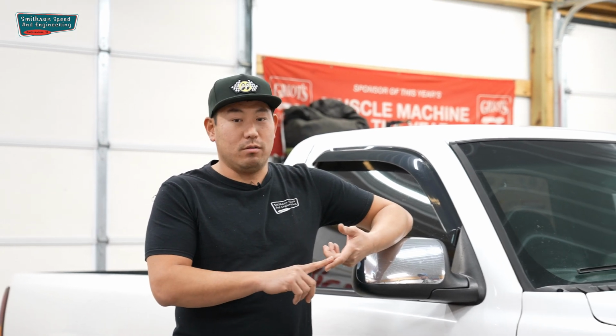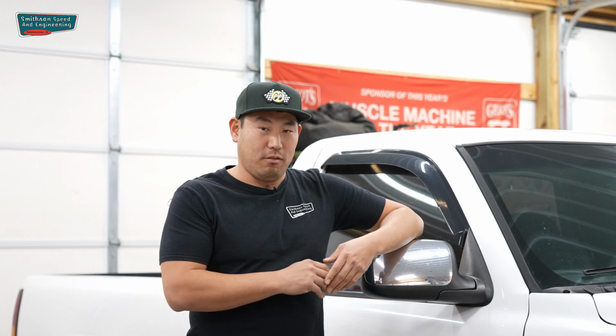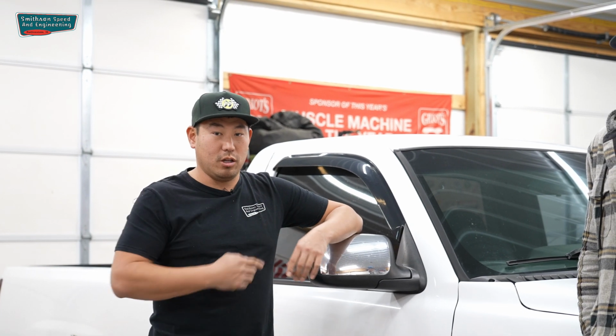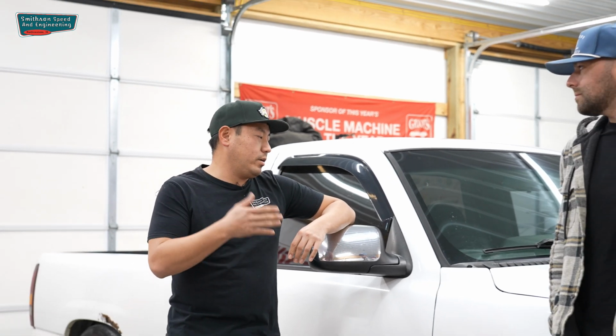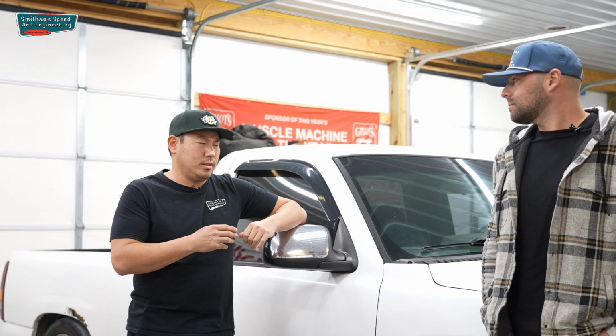But the big thing was obviously we wanted to do a T-56 Magnum in this, and we went to American Powertrain and got that from them. For the T-56 Magnum, we used a factory Silverado clutch pedal assembly that we retrofitted in there. We had the one-piece aluminum drive shaft built for it, and then I think that's about it, right?